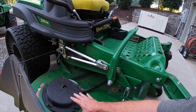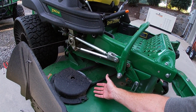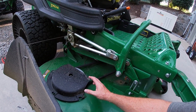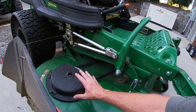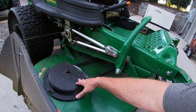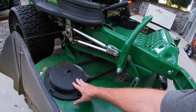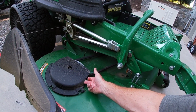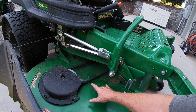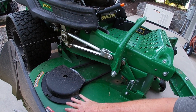There's so many different things that this helps with. First of all, that dead grass, leaves, stuff gets trapped underneath these covers, and there's no air in there, it doesn't let this cool, and it makes these spindles run hotter. So first of all, it'll make your bearings have premature failure. The other thing is, besides all the grass hanging here, it'll hang in all the cracks and crevices, it'll pile up underneath the belt, and the one thing that grass does worse than anything else is it holds the moisture.